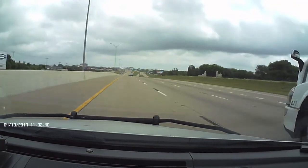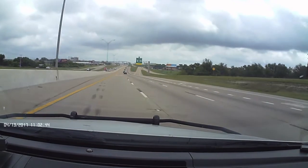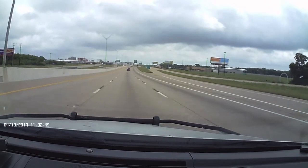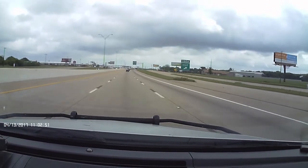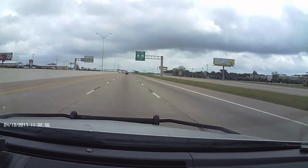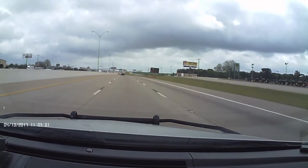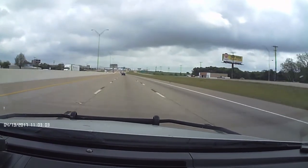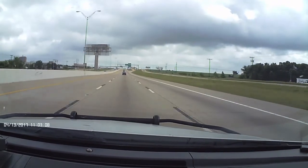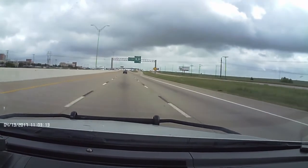like I said, buying a used car, particularly a police car that may have been driven in a lot of gravelly roads, areas with a lot of tar on the road, take your wheels off, clean them, you may be surprised how much better your ride is. I really thought it was the light bar on top of the roof that was making the ride so rough, but it wasn't. It was obviously those wheels being out of balance.